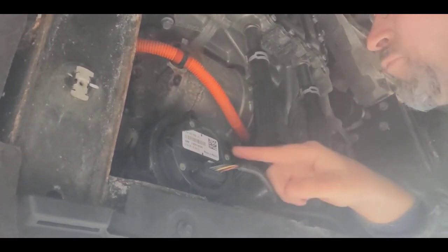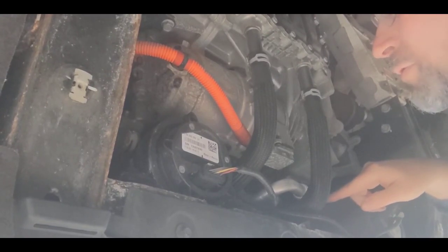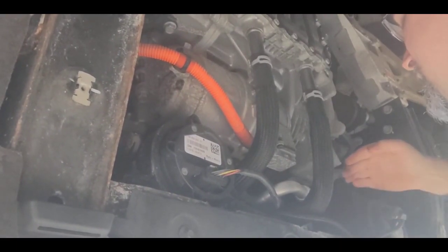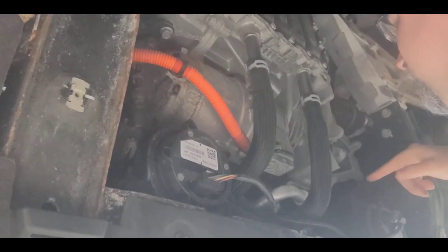The outlet from pump 1 has to go up, down here, and then up to the first component of the powertrain, which is the hybrid power module - the inverter. That would be the outlet. There will be another pipe coming in this direction going to the surge tank up there, which is now the battery surge tank. There'll be two branches: one connected to the outlet of pump 2, and the second further up connected to the chiller through a check valve.